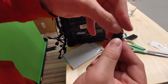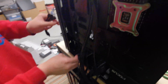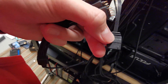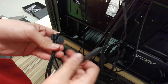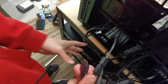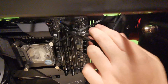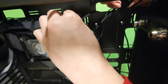Now grab the 1-to-4 cable that came with the EK RGB kit. Find all the components that have RGB headers on them, match the little arrow on each connector with the arrow on the cable, and plug them in. Connect all the RGB connectors together and make sure to align all the arrows. There is also a 12-volt RGB header on the motherboard — face the arrow toward the 12V symbol and plug it in.